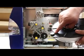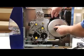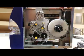Then, take your roll of labels with the touch cell side down at the 6 o'clock position and slide the roll all the way to the back of the media spindle. Then, take the tab of the media and rotate it counterclockwise so that the touch cell locks into the memory cell reader.